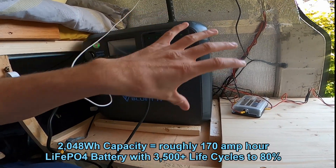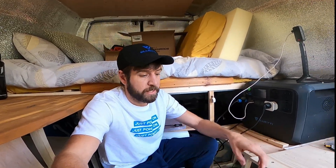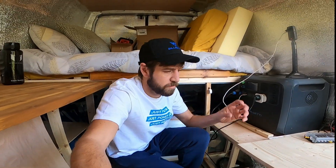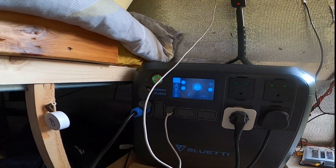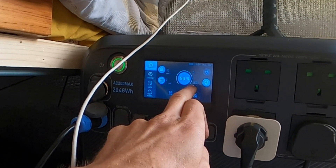The bottom half has a battery in it and there's also an inverter in there as well. The inverter is a 2200 watt inverter, so in total you can use up to 2200 watts. To give you an idea of what that capacity looks like, I've got an electric heater here that is 1700 to 2000 watts — that's its maximum. So if I plug it in on the highest setting you'll hear the Bluetti kick in. It's got two fans — a suck on one side and a blow on the other. That's pulling in almost 1900 watts, which gives you an idea of what that inverter can handle.